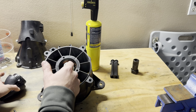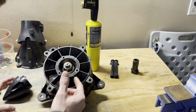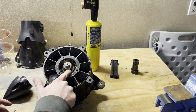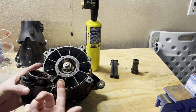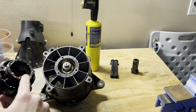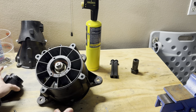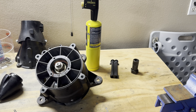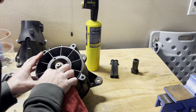Doesn't appear to be any surface rust, and typically even if you're getting just a little bit of salt water in, you get some kind of surface rust on it, but it does look like it's just the red and the yellow pump bearing grease starting to get mixed together. This thing only has probably 10 hours on it since it was rebuilt by the dealership, so we would hope that it is not leaking. It doesn't appear to be at this time.